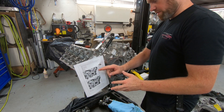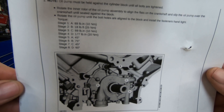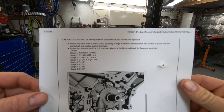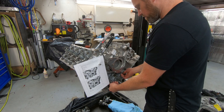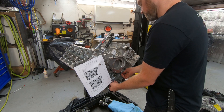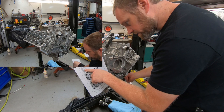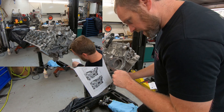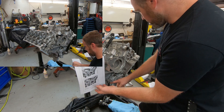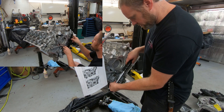I'm going to throw an image of this torque spec sheet on screen — it's a very interesting torque procedure. We have four bolts total, and it looks like every bolt has its own separate torque. Stage 1A is 89 inch-pounds, or 10 newton-meters, on bolt A — the little bolt down here. I have this guy already set to 89 inch-pounds, just verifying it quick.